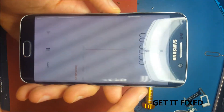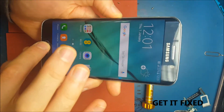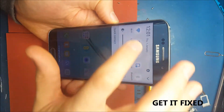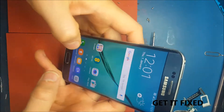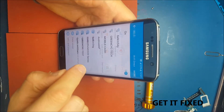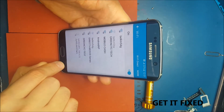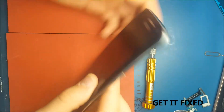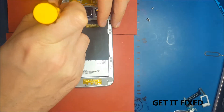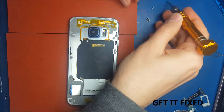A very important suggestion: make sure everything works fine. You don't want to reopen the phone after it's closed. If the earpiece doesn't work or the sound doesn't sound proper, it will be really hard to reopen everything. And in the meantime you can damage the back glass as well. Because this back glass, as I said before in the previous video, if you use too much heat to take it off, the paint from the actual glass will come off.